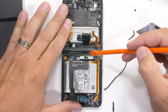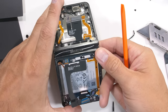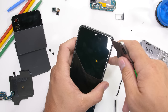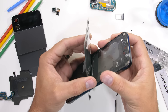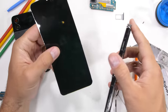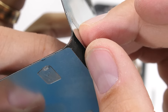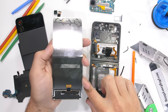One thing I'm not going to do this time around is remove the batteries. Since Samsung is rather rude with their adhesion — glueaholics you might even say — Samsung makes safe battery removal impossible. And since our flip has at least a 9% chance of surviving all of this, I'm going to leave the combined 3700 milliamp-hour capacity batteries intact. The flexible screen, hopefully still in one piece and functioning, can be fully removed from the phone at this point. When left at rest with no forces acting on it, there is a slight natural curve in the center, and that natural curve is supported by the rubber and metal slats that we've seen in previous years.